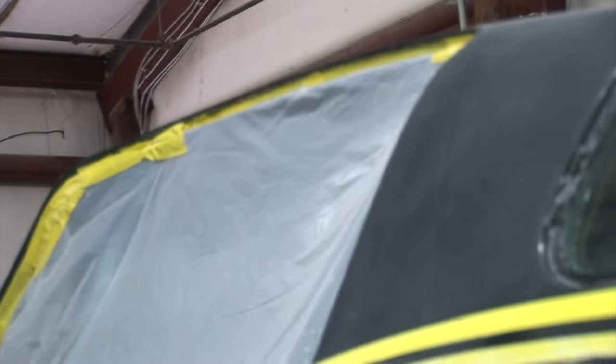So with all this extra fiberglass, and like I showed you in the quarter panel, it was all pretty thick fiberglass all through this section from maybe a repair during the 70s or 80s or whatever. But when it got pushed in on this side, it couldn't absorb the impact, so it just transferred all the force through the car, and that's why we have a crack up on that top, up there on the front pillar, and little ones up in the top. So I just wanted to go over it real quick.